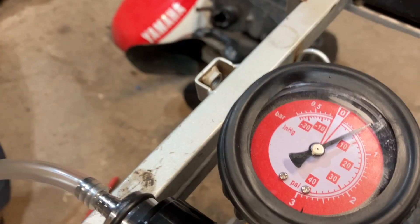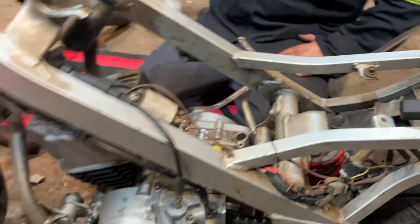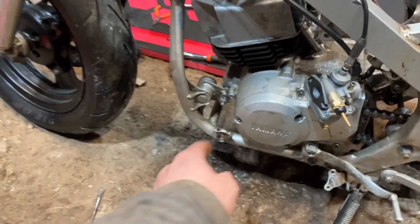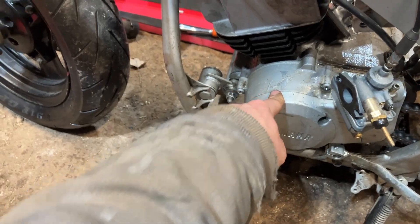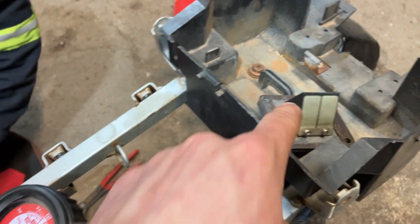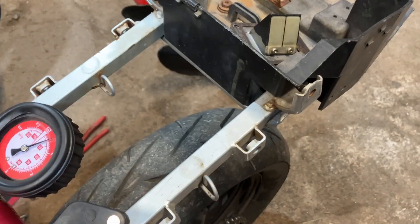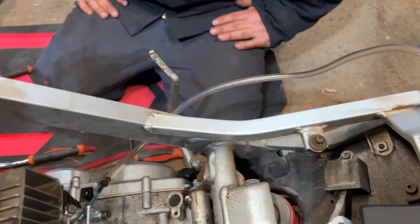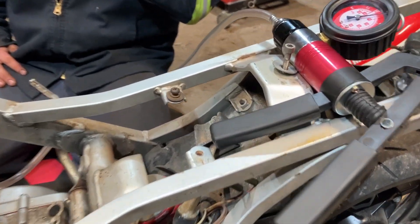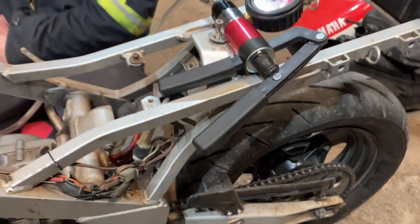That's not the engine's fault. The way it's holding pressure, I'm pretty pleased with the health of the engine. We checked underneath — crankcase split line, base gasket. We did do the left side crank seal and I highly doubt that's leaking anymore. In my mind, the engine is healthy. I think maybe most of our cause was those reed petals being flipped, having that huge gap. Reeds will make it run rich if they have a gap like that, and you get some spit back.